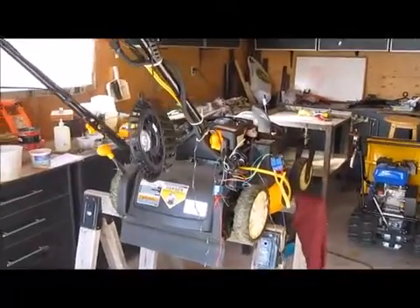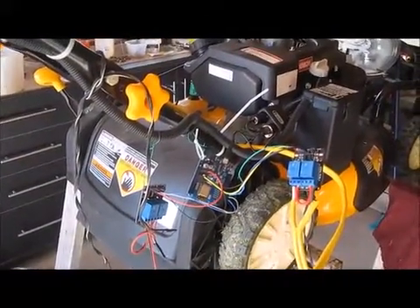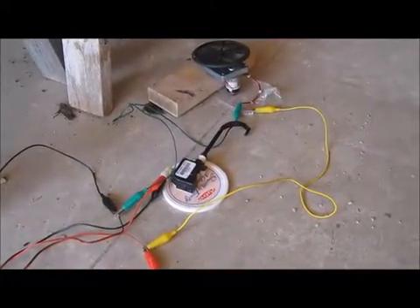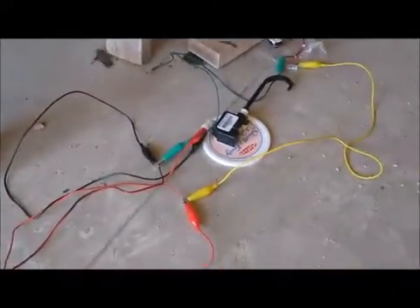Here's my lawnmower. I've been doing some more testing. For now I have two relays hooked up to it — one to engage the starter, and the other is a single pole double throw to operate a linear actuator and the steering mechanism, both from Princess Auto. They're hooked up to the same relay just for testing purposes.